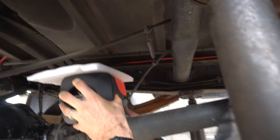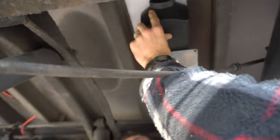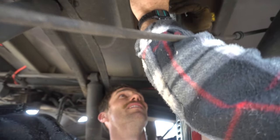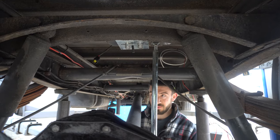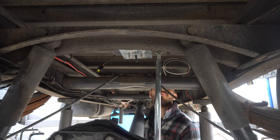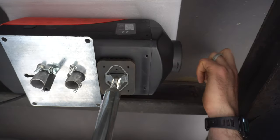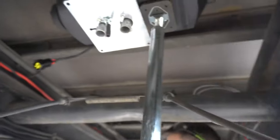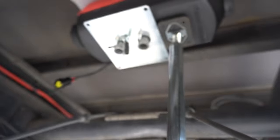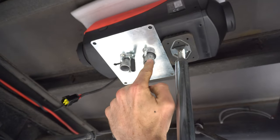On to the main body now — getting her in place. Hot air is coming out of this hole and it's going to go up into the van. Cold air comes in this side, hot air comes out this side. We've got one exhaust and one air intake. The rubber bit is where the fuel goes in, the one beside that is the air intake, and the other one is the exhaust — so they both need to point to the rear of the van.